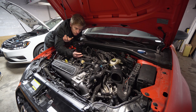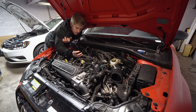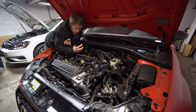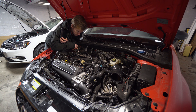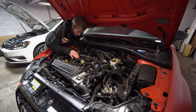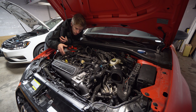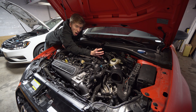Oil can also create hot spots on the pistons. So, hello Forge engine oil catch can kit. It will bypass the PCV hose from the PCV system, hopefully separate any oil, and then reconnect to the inlet. Traditionally, right off your PCV there's a hose that goes to your inlet — it's supposed to suck in any unspent fumes. If your oil separator isn't working correctly, you also get oil going into your intake, which is not great.